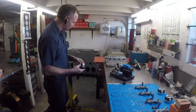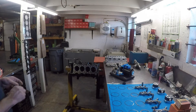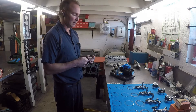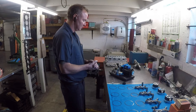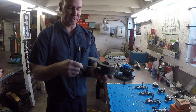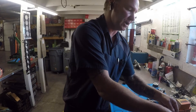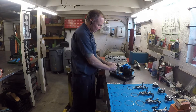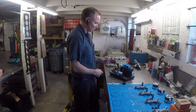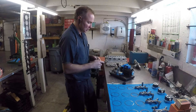What you need is a set of feeler gauges and some sort of a ring grinder. For years before I bought this really nice Total Seal ring grinder, I used this manual one clamped in a vise. The disadvantage is it's much harder to keep your ring square. With the Total Seal ring grinder you can adjust this knob to make sure the ring is square to the stone where you're grinding it. On the back side there's a rubber wheel to deburr your rings.